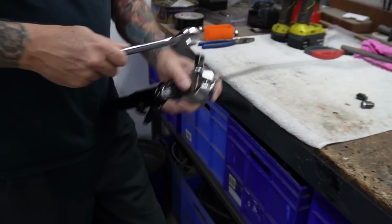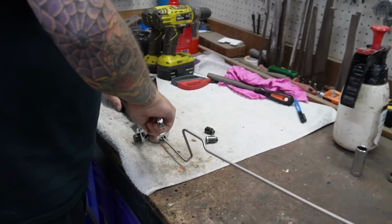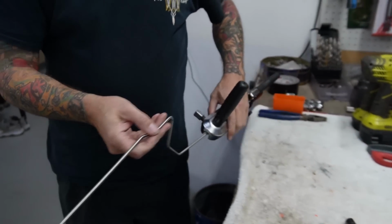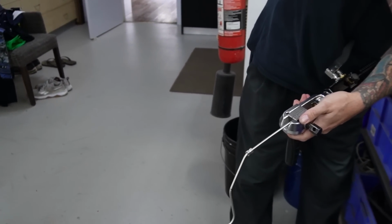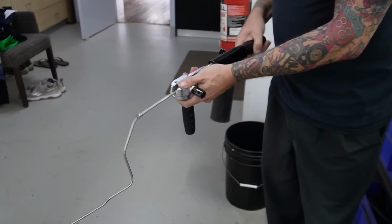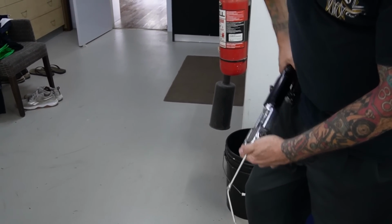And like myself, he's had a couple of different versions. Yeah, this is the best one I've had, especially when you're doing stainless. Stainless stuff's really difficult to work with, so it's harder to flare, obviously. But this has been the best one I've ever used. Most consistent anyway, to do double flares. So double flare, the first little fitting bends it one way, and then this one will bend it back the other.